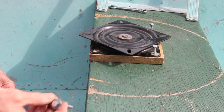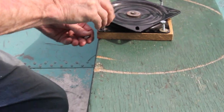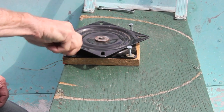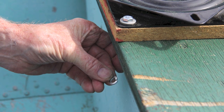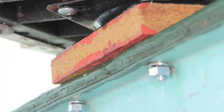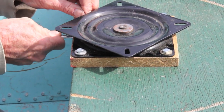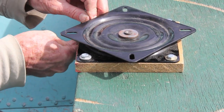After the back ones are finished, we're going to install the bolts at the front. One thing to remember when installing the machine bolts is we want to put the regular washer on top and the lock washer underneath, and then the nut up against the lock washer. Here's a quick look at the lock washer as well as the whole assembly once it's put together. Once that's done, we tighten everything up to make sure it's good and secure, and then we're all set to install the seat.